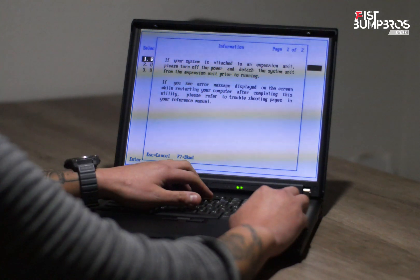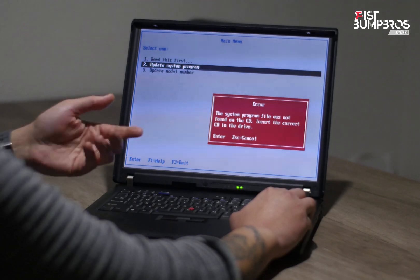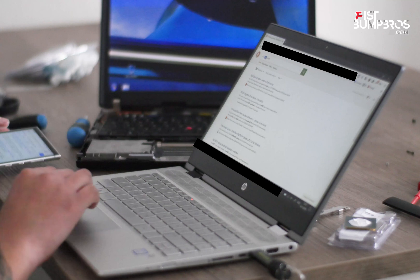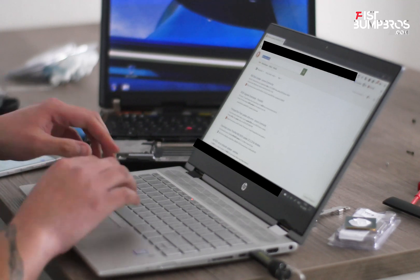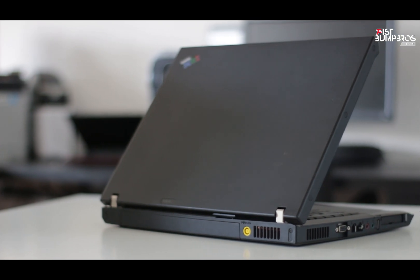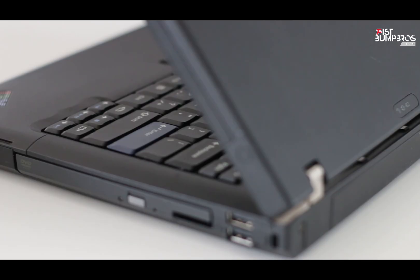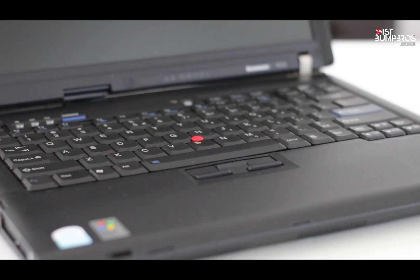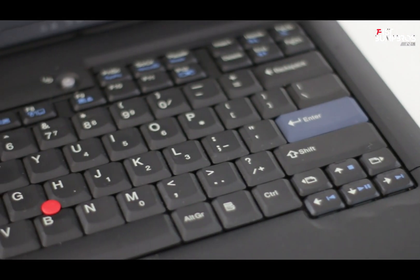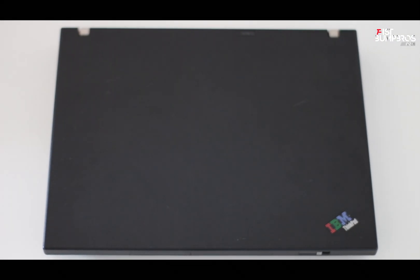It gave me a menu screen I'd never seen — and then an error screen, for no reason. So again I went searching on the Lenovo website, digging into old forums, and I got the correct answer this time. Turns out I had been fooled: I bought a Lenovo R60e instead of the original R60. The R60 only takes a T2700 CPU, and the R60e only takes a T1350 single core CPU — not that special dual core CPU that everyone wants.